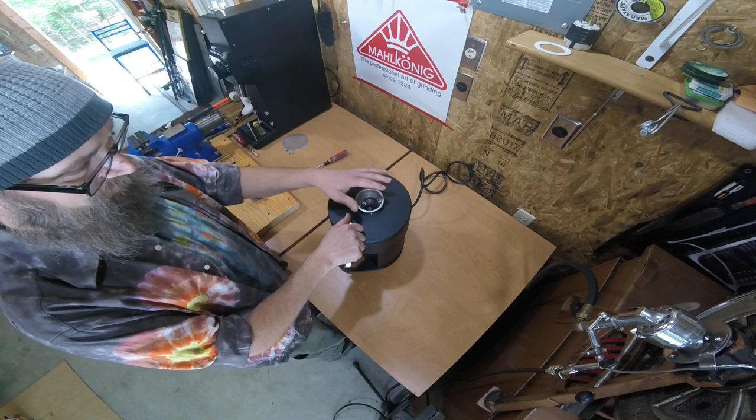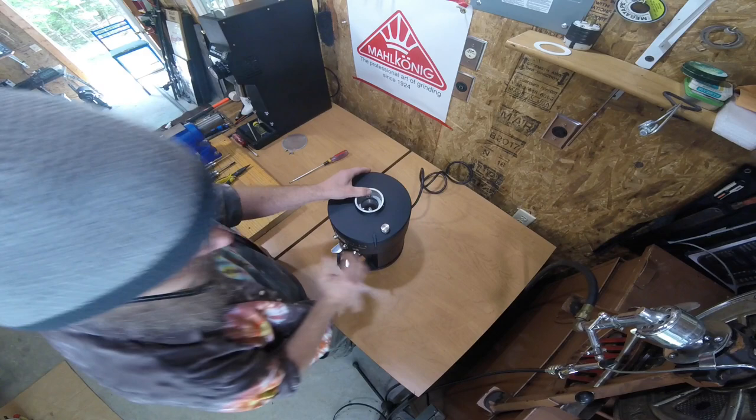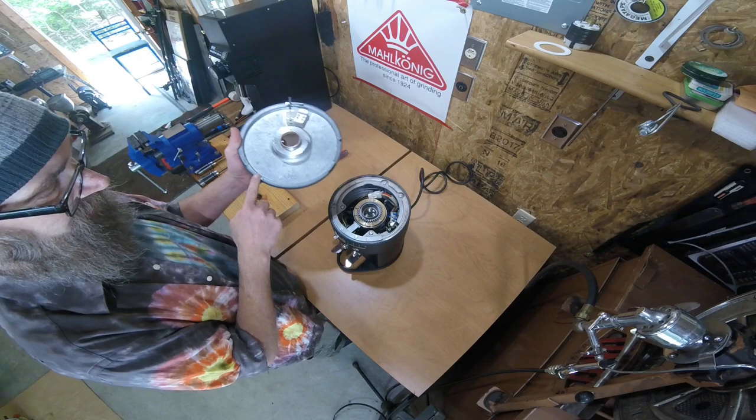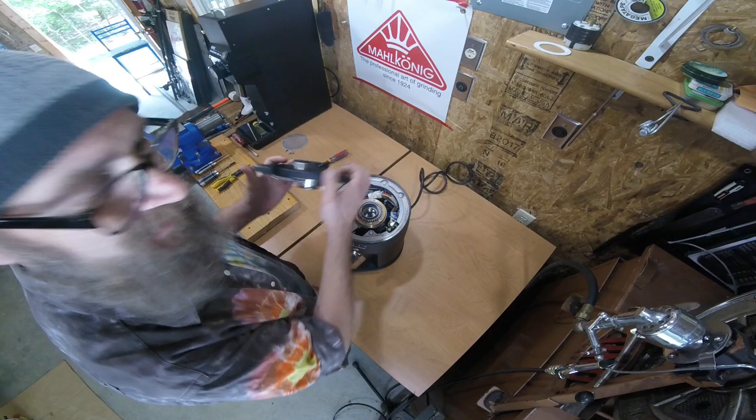With the set screw and hopper gasket out, we will unlock the lid, roll it over to the coarsest position, and if you just pry up, usually it comes off. You'll notice there are three little studs that go into three tiny little cutouts — that's how you know what position to take the lid on and off. And we are not plugged in.